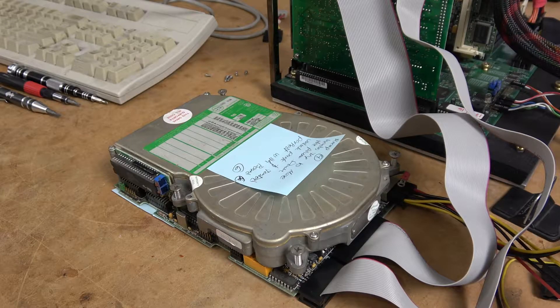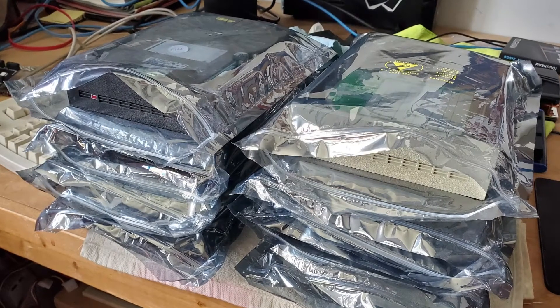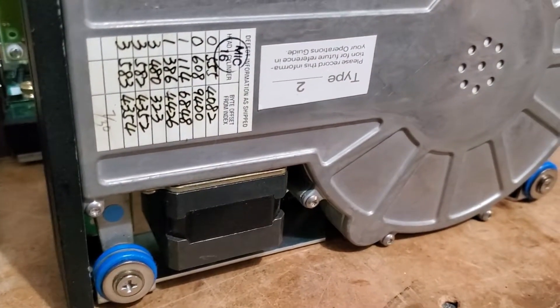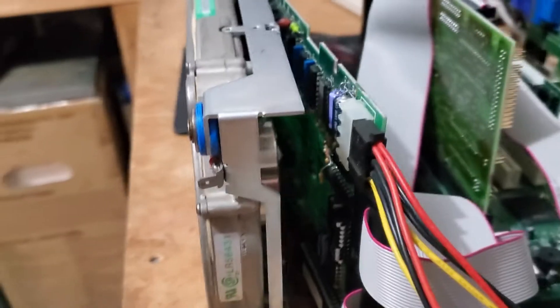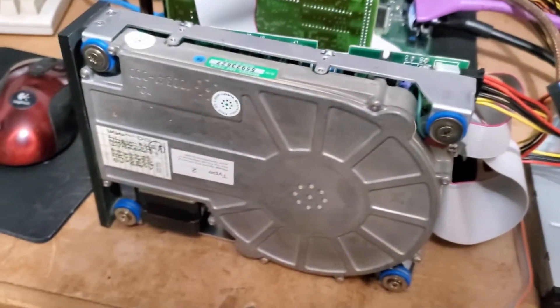Welcome to Hardware Asylum. I recently picked up a bunch of really old hard drives and they're all Microscience — MFM and RLL drives. The first one I got was the model HH725A, a very old drive that had one of the external servos. The drive works but it won't power on by itself. If I move the control board out and spin the motor at just the right point it will continue spinning, and I was able to format the drive, fdisk it, and run some benchmarks that didn't really ever complete — but I never expected them to.